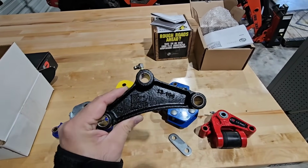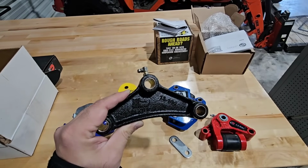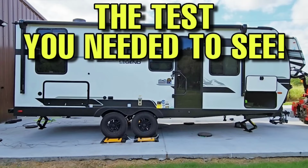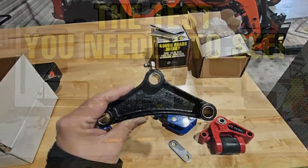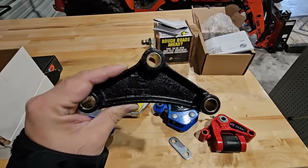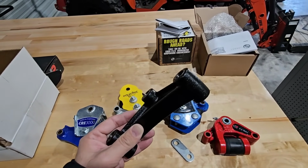So an equalizer plays a very important role on RVs. And I showed in a video where we actually weighed the Surveyor with different angles, and it shows how much transfer actually takes place in terms of weight between one axle and another axle at various angles. So even though this is designed to equalize, it doesn't necessarily equalize exactly.